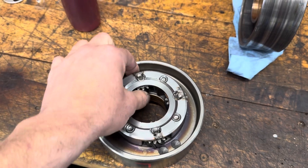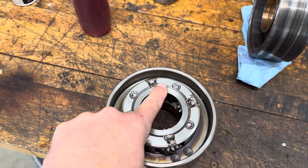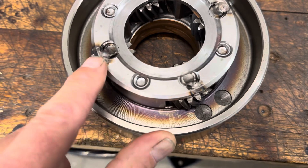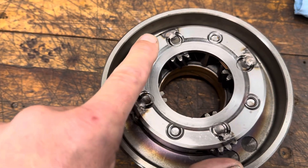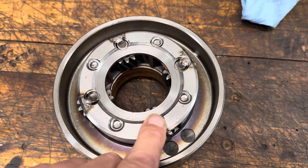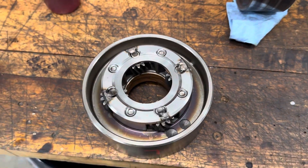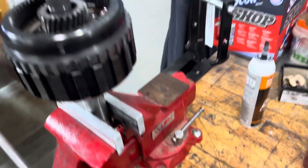This is from the era before I knew about swaging these pins, so everything I did was TIG welded. You can kind of see the pins are some sort of powdered metal, and they really don't like being welded — they're very messy, very oily. I quit welding them in favor of swaging the pins. Kind of a neat little mod I thought I'd share with you guys.